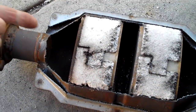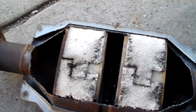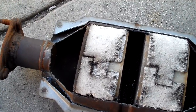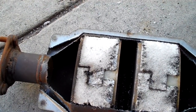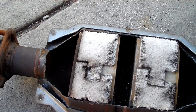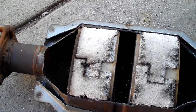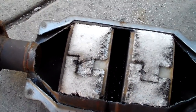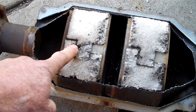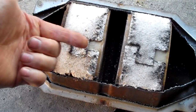So this is the flow for this one — it goes through this way. This is the primary catalyst, called the reduction catalyst. What it does is it rips oxides of nitrogen — NO and NO2 — basically it rips the nitrogen off, because this is coated with platinum and rhodium, and the nitrogen sticks to it as it's going through. But only when it's hot.